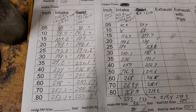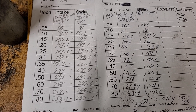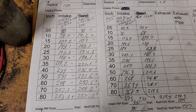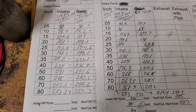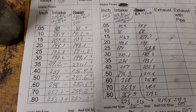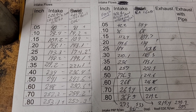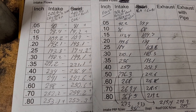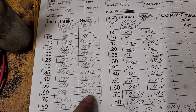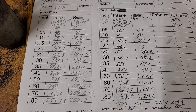The 041s come with a very low short side radius, and the port itself is not that high, the bowls are not that deep, so it's a relatively flat port. That doesn't mean it can't make great horsepower - I was reading that Larry Moe did some 041xs with 194 valves and he's getting like 580 horsepower out of them, super stock stuff. I don't expect these to do that well, but if we put a decent size roller cam in at 250, I think by the time I get a decent valve job on here they should be around 260.